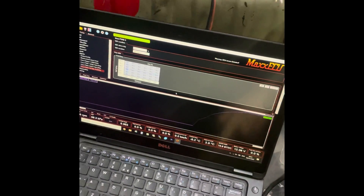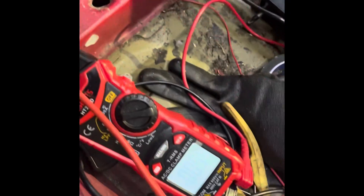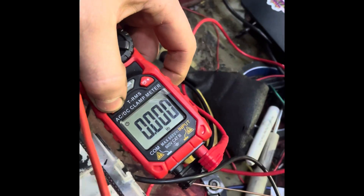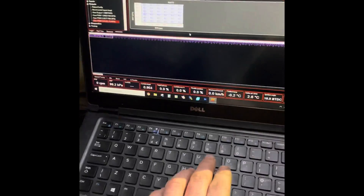How cool does that sound? What we'll go for is 100% run, which will be a bit hard on the reg because it's got two pumps shoving fuel in it and it's probably going to start chattering — but we'll see what it does. Full pressure. Right, you can hear that little reg — it can't keep up with 35 amps and 500 kPa. We're going to have to bump up that fuel reg to really put it through its paces.